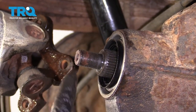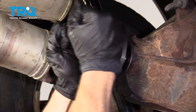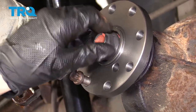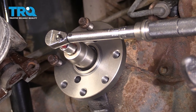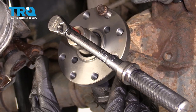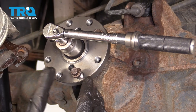Let's wipe off the threaded area and apply some red thread locker. Let's go ahead and get this on here — I'm just going to twist it a little bit until it lines up the splines. Give it a couple loving bonks. Now let's clean up all the threads on our bolts, take two of our bolts and insert them into the new flange, and install our brand new nut. Now let's bottom this out. I've tightened this up a couple of times and rechecked it. I can pull on this and it can still spin without even getting a click from my wrench — that tells me I still need to tighten a little further. Right where I have it now, the torque wrench just barely makes its torque at the same time as it tries to move this pinion — that tells me I have it perfect, matching the original measurement I took.